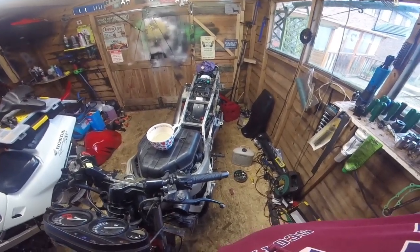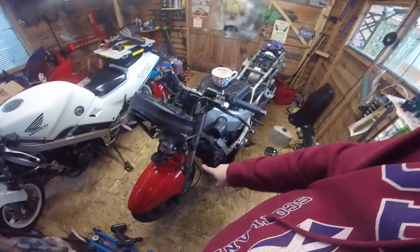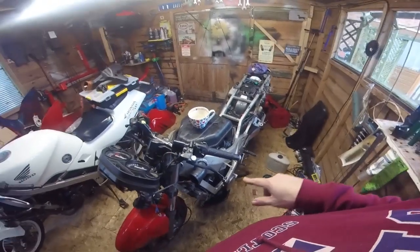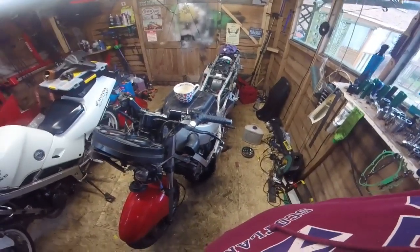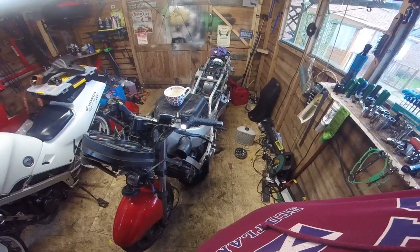I've got to put the coolant back in. It takes 2.5 litres. I'm going to try and get the oil filter off, and I think I can do it if I just swing the oil cooler out of the way, hopefully, fingers crossed, because it's got an aftermarket exhaust on it. It's got a full Micron on it, and it's a little bit cheeky, but not too cheeky. So it is a race system, but it's not obnoxious, unlike the owner. So I think I can get the oil filter out of the way. I have got an oil filter. Makes sense to dump the oil.